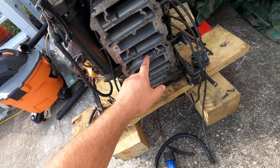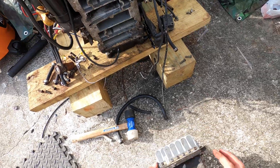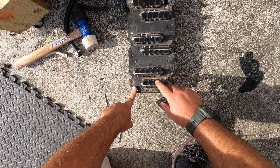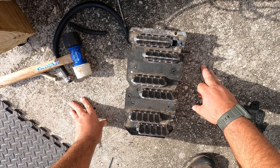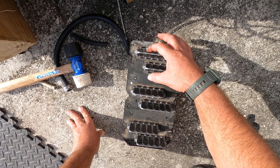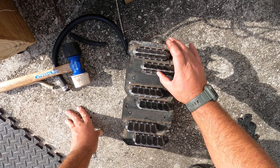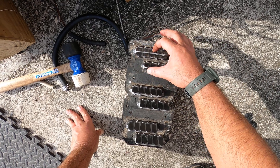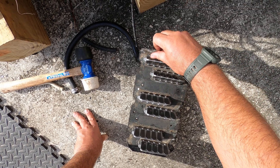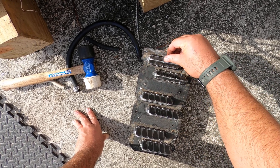It looks like a little bit of water got in there. I'll have to replace this gasket, of course. Here are the reeds — these are the original steel reeds. Looking them over, it doesn't look like they're sealing up too good. I don't have a feeler gauge but there is a measurement for that. I have a feeling they should be fully seated like the rest and not opened. It might be within specs but it will cause issues and it means they are failing.